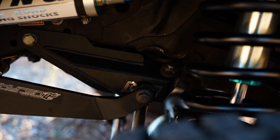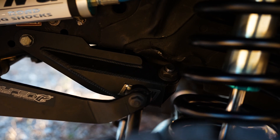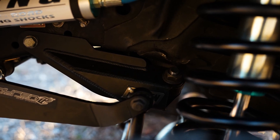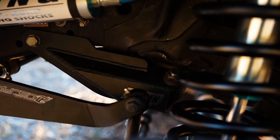With this system on the truck, plus the 35-inch wheels and tires — and I did a whole video on tire pressure that helps with that — I've pretty much checked off every box right now. One final piece I didn't talk about in this video was the track bar. You do need a track bar when doing a three or two-and-a-half-inch height system. I'm actually beta testing the Thurn second gen track bar, which Thurn is about to release. At the time of filming I've already put it on — it's pretty sweet — but I'm going to do a dedicated video just for that.